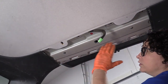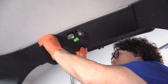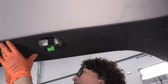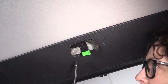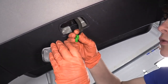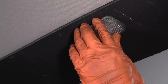Now we're going to install the piece on the tailgate in the center. First thing I'm going to do is put that wire through so that I can use that to plug in the dome light, guide these up in — the plastic trim — and then just give it a good snap up. Now this has a little screw that goes in the center here, and it's a Torx head T25. Now we're going to plug in the rear cargo light — snap that in place. You can see there are two little tabs by the electrical end and then the push-ups, so guide it in this way and then snap it up.